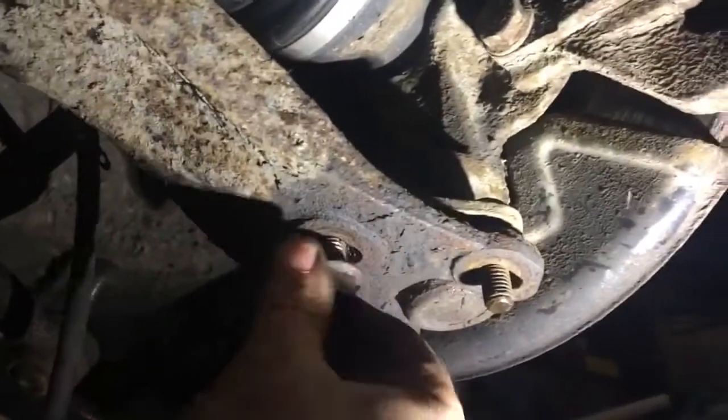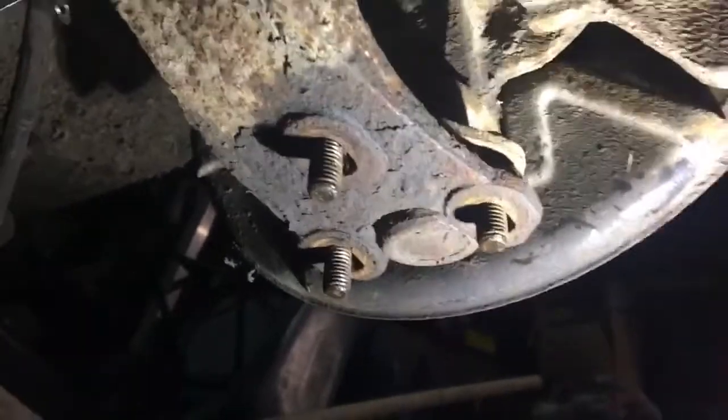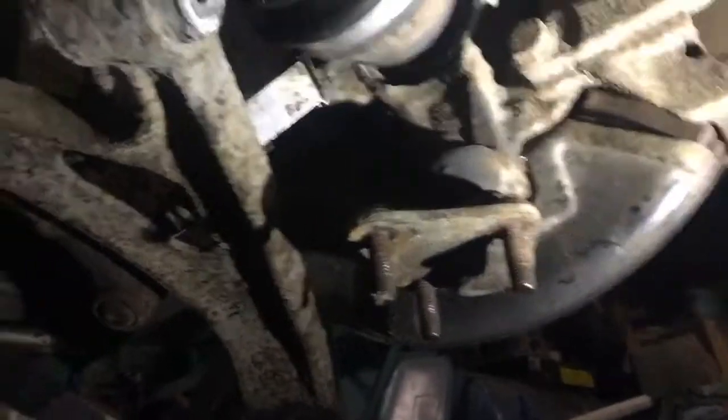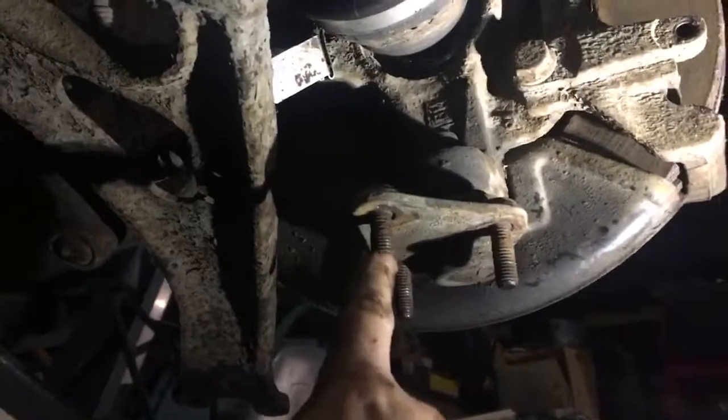Just doing the bottom ball joint — the nuts are 16mm. Now that the bottom ball joint is nearly fully removed, take a hammer and give it a whack, drop it down and that's that one done. Now up to the top. I have the drive shaft out of the centre — that's the drive shaft out, it's still hanging off that nut there. Obviously when you wind it out you put it in a few threads otherwise it will fall down on top of you.